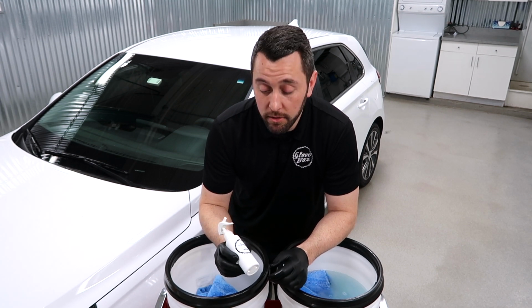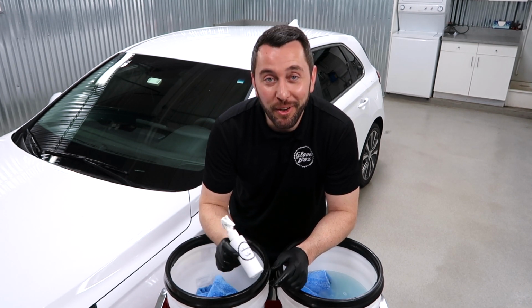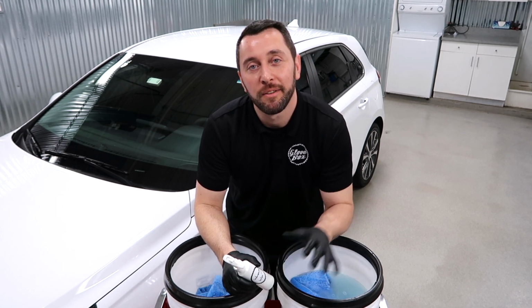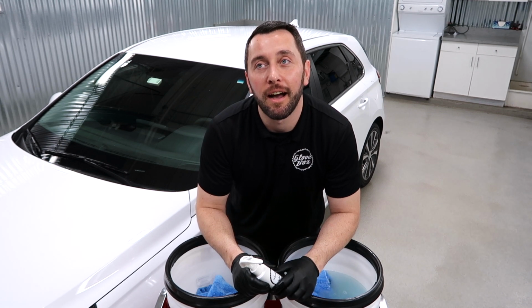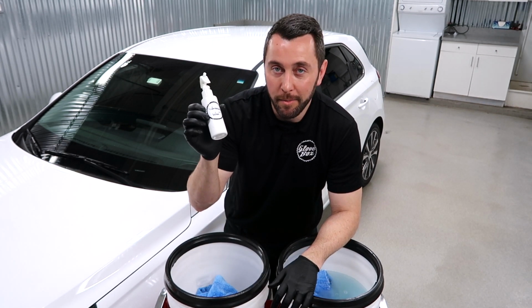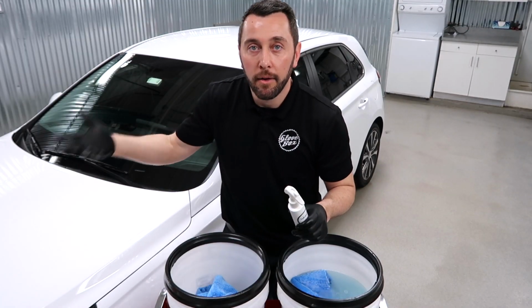If I try to break it down to you, you will quickly realize I went to public school. But I'm telling you, 1 to 15 for the waterless wash, 3 gallons of water for the rinseless. You're using about the full 50 milliliters or 2 ounces. So waterless, I'm using like a detail spray. Great sound effects. Wipe down like we've done in the past.